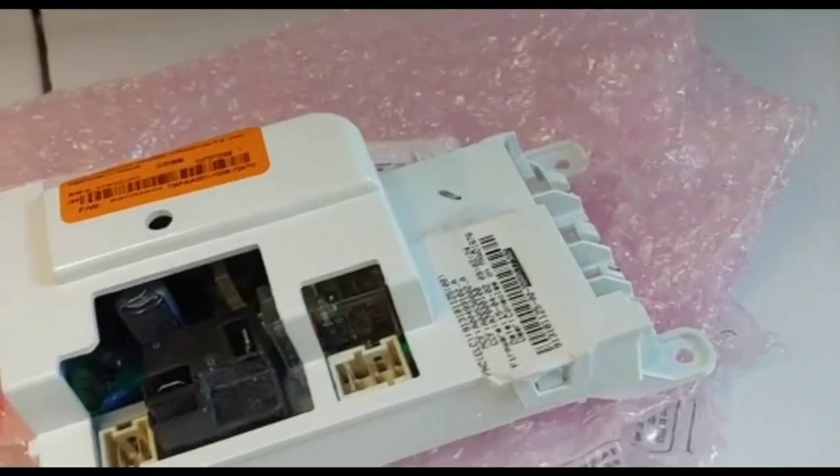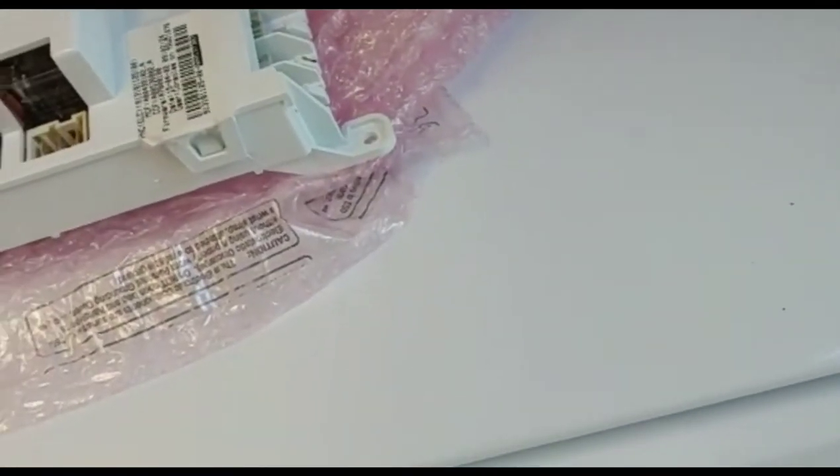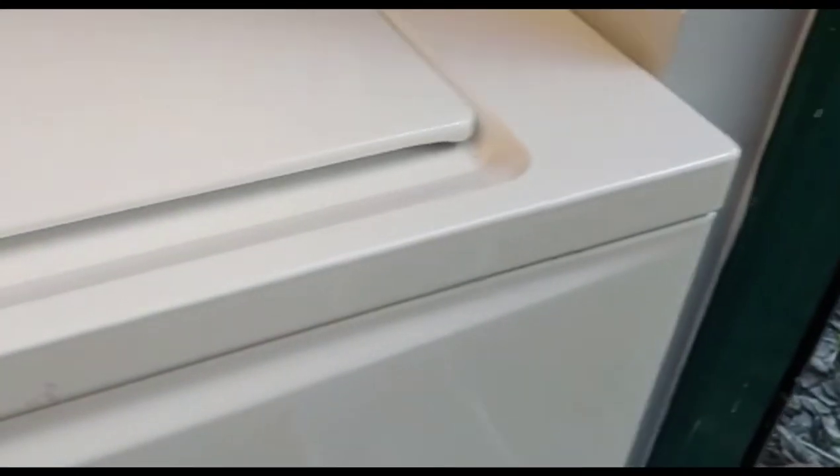What happened with the position where it's located — I'm gonna open it and show you. It's very easy to change. They make it sound much more complicated. You don't need to take the top panel off, you just lift it. You don't need to take this one off either — you just remove this panel, which is held in place by two screws at the bottom and then it slides up. You've got to release two clips here. You can use a scraper, a spatula, or even a screwdriver — just put it there and pry it off. It's held in by pressure with two little metal clips.